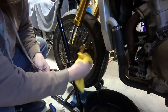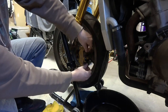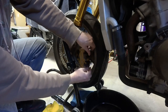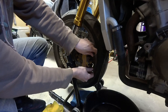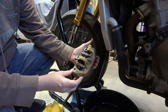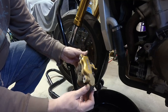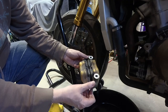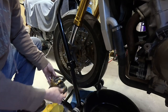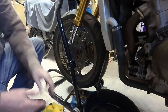We're getting a little bit of fluid out of the caliper itself. I've already cracked the two caliper bolts loose, so those two bolts and your caliper's off pretty quick. As you can see, this caliper probably needs a little bit of servicing—it's pretty dirty. Definitely needs a good cleaning; a lot of brake dust and carbon buildup. I'll put that one aside and go to the other side.